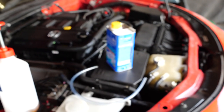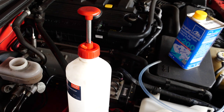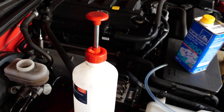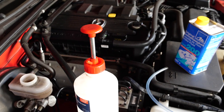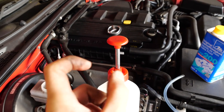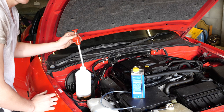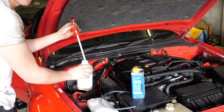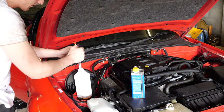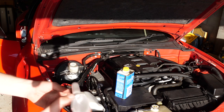You're meant to change brake fluid every two years because it's hygroscopic and water gets into it. Brakes get really hot — over 100°C — and what happens to the water in the fluid is that it turns into steam, which expands. When you push the brakes you get no braking effect because you're compressing air rather than hydraulic fluid — that's brake fade. Using an old pump to extract the fluid, then a little funnel to pour the new brake fluid into the reservoir.